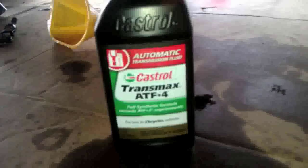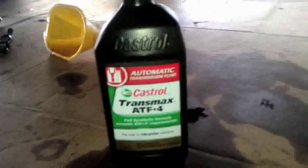With just a regular change and no overhaul, you've got to put in ATF4. If your car previously had ATF3, ATF4 will work as well. Pour that in — 5 quarts if you didn't do an overhaul, just like what I did. See if there are any leaks; if there are, then you get to take the gasket off, drop the pan, and do it all over again. Hopefully this works. Comment if you have any questions, like it if this helps you. Good luck!